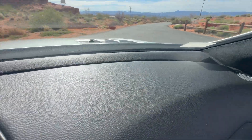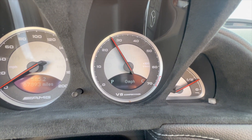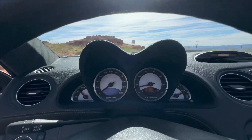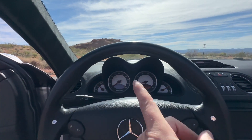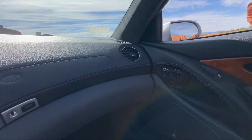The dashboard's in great shape — don't have any of the peeling there. Let's do a little rev of the engine just to show that there's no smoke or anything that comes out, especially after it's been idling for a while. If you've got weak valve stem seals, you'll start to collect oil in the combustion chamber, and the first time you rev it you'll get a plume of smoke like you're a Panzer tank or something. Something to check when you're shopping for these — but no issue on this model.